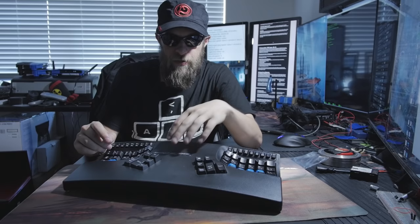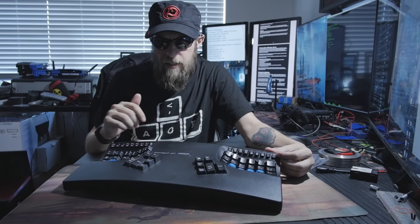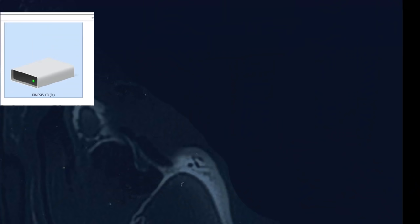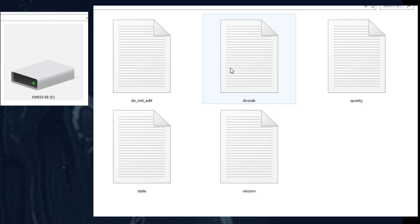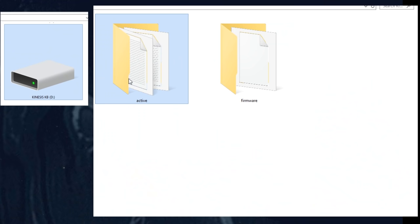The really awesome feature of this keyboard that I want to mention is the V drive. Basically, there is a 2 meg flash on this keyboard that you can access via your computer. You have to put it into super user mode — or as I like to call it, Deus mode. You hit program, shift, and escape, and then from there you can hit program F1 and you'll access the V drive. It'll automatically mount to your system. If you're in Windows it'll show up as a removable drive; if you're in Linux it'll just pop up into your system; if you're on Mac it should just pop onto the desktop like any other USB drive. The keyboard still works as well — it's not like you lose access to it.